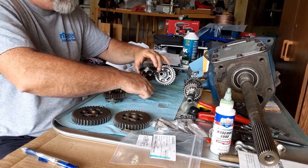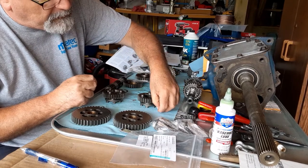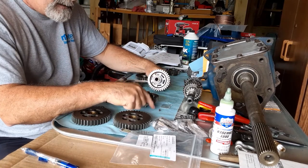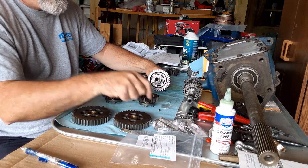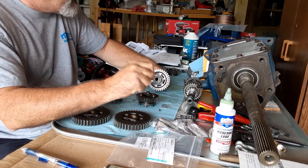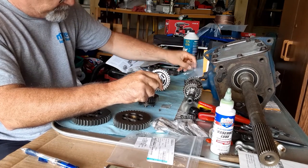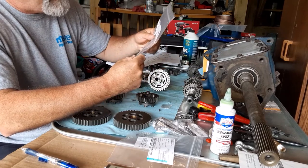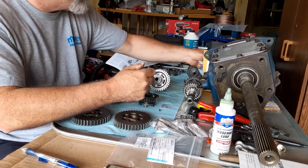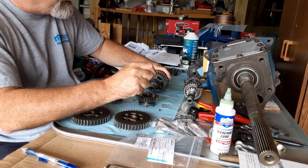There are my three balls and my gear. I've already checked these before I started the video and they all appear to be healthy. The nominal size is 3.95 millimeters — checked them with my calipers and they all read good. I got some new ones from KTM, also 3.95, but one of them doesn't have any chroming on it. That chrome is crucial for keeping it from sticking, so those are going to stay in the bag.